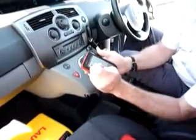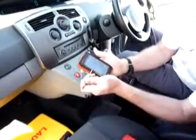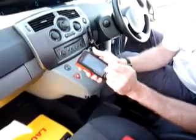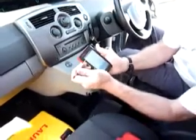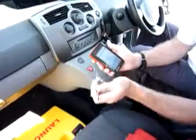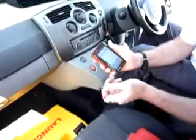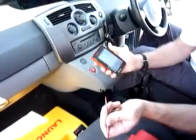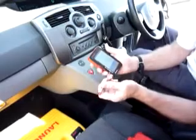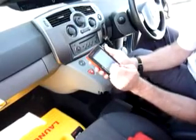Let's go to Injection. It's now reading the data from the injection system and comes up with various information on codes and serial numbers. Press OK to go deeper. It's got computer identification, read fault code, clear fault code, read data streams, and actuators. Let's read any fault codes. It says no fault codes, so there were no fault codes to clear. Read data stream — it comes up with several pages: impact detected, computer temperature, after ignition, inlet air temperature, water temperature, rail pressure, alternator flow, synchronisation, engine immobiliser.